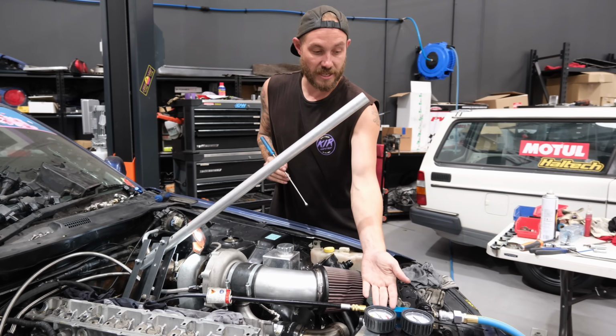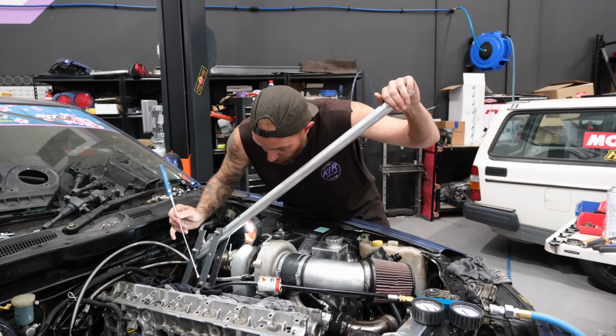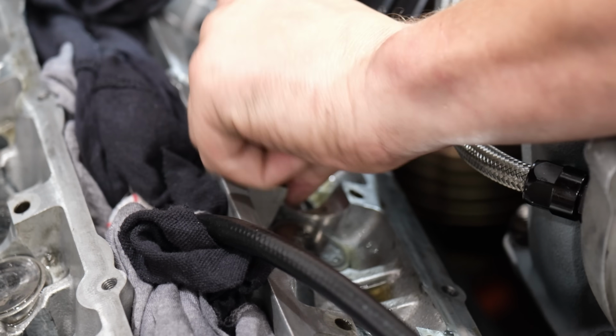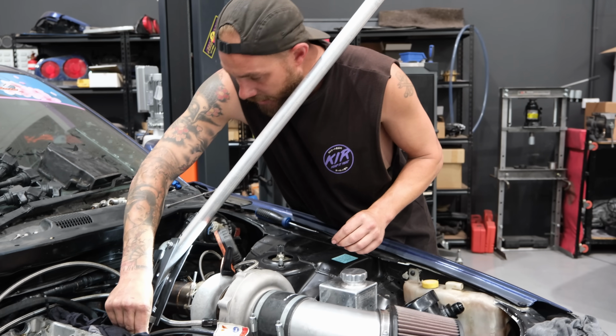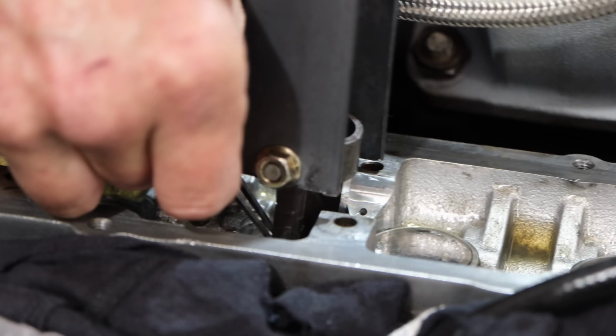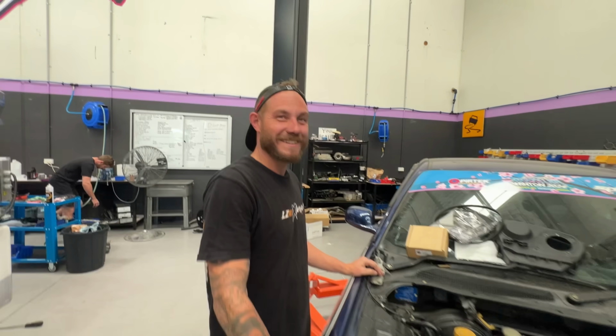We've got a leak down test here, holding pressure in the cylinders so the valves don't drop down into the cylinders. I'll pull one out, trusty magnet, and pull the air collets out. Now I'll lift this out. And as you can see, the valve hasn't dropped into the motor because we have it under pressure. Got the new spring. Sit the spring in, line it up, down. With a bit of luck, a new valve spring in.